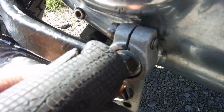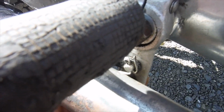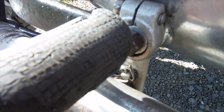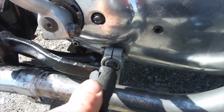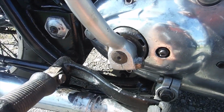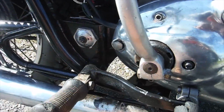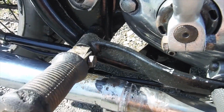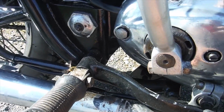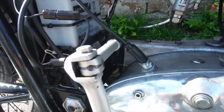In that gear lever, originally the linkage mated up with that hole at the furthest point away from where it pivots, so I drilled another hole closer to it, so that reduced the travel necessary to make the gear changes. And I also adjusted the angle of the mechanism and made it more parallel and closer to 90 degrees than it was before, so that should help as well. Even that wasp seems to approve.